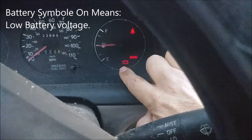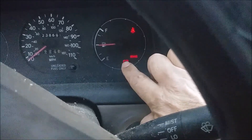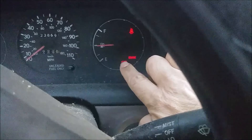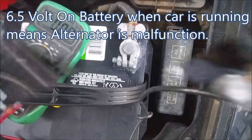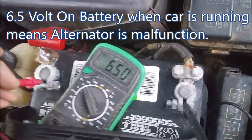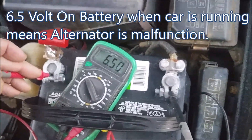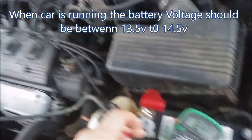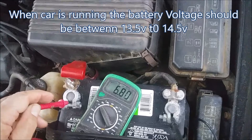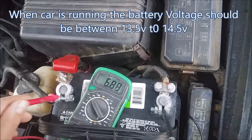This is a battery issue, but it's not really the battery — it's the alternator. I'm putting a voltmeter on the two connections here. The voltage should be at least 13.5 volts when the alternator is working. So the alternator is dead and has to be replaced.